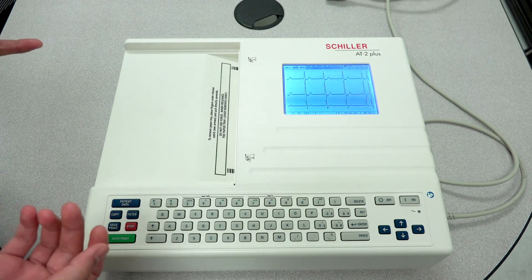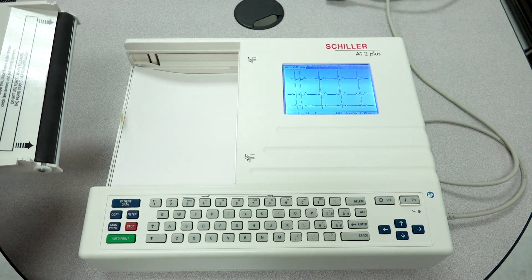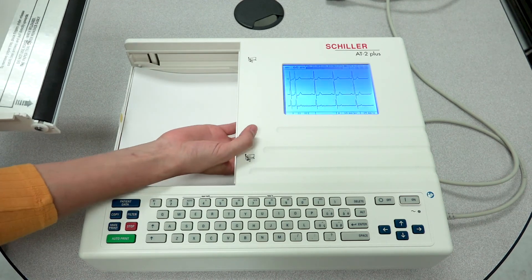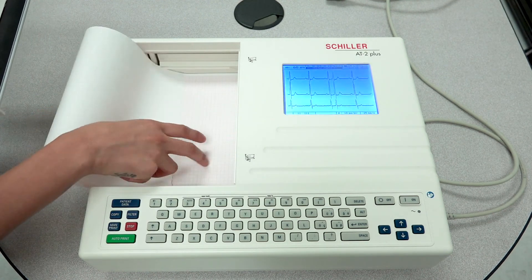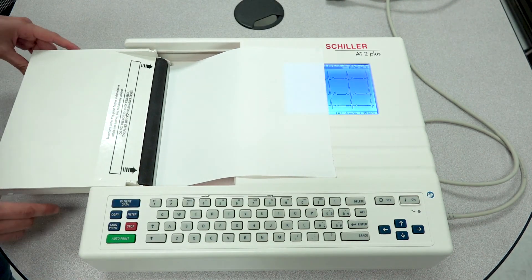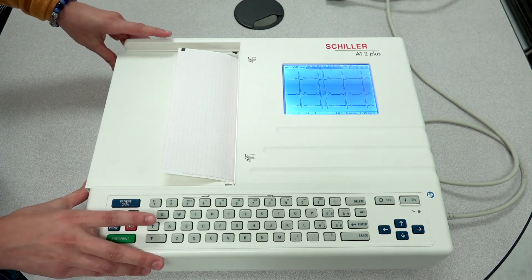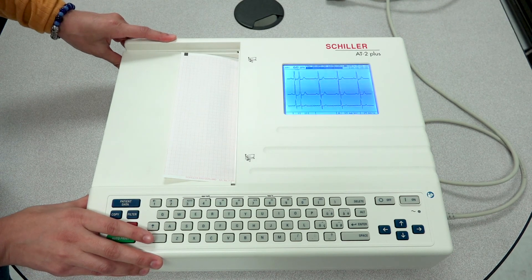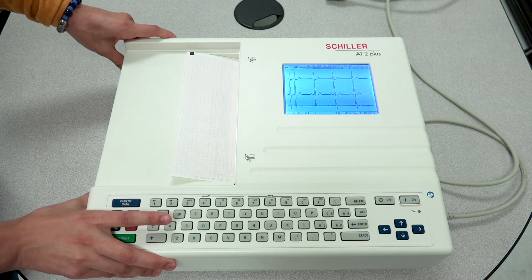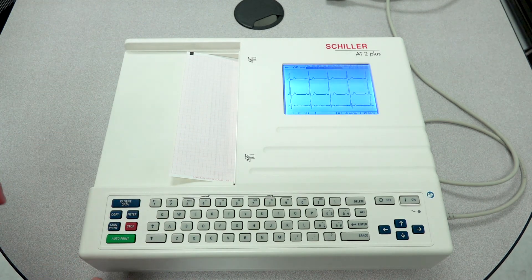What you need to do now is go ahead and remove the paper door, make sure the paper is in properly, and pull out that first sheet of paper as we did before. Please properly ensure that your paper drawer is sliding in nice and smoothly. If you feel any resistance whatsoever, please stop, because it could be that your print head has misaligned or possibly even fallen, which is a major issue — you won't be able to get any print after that.